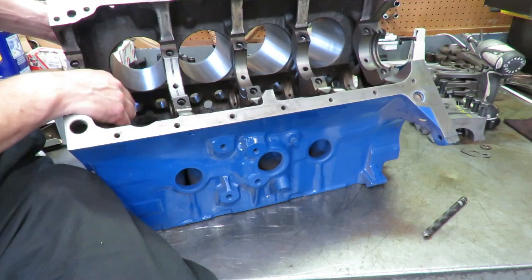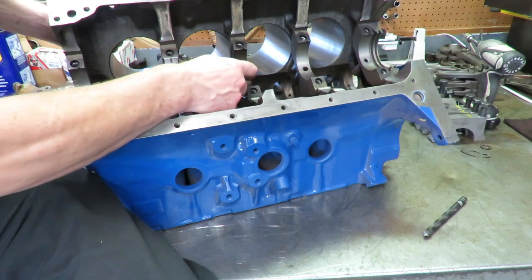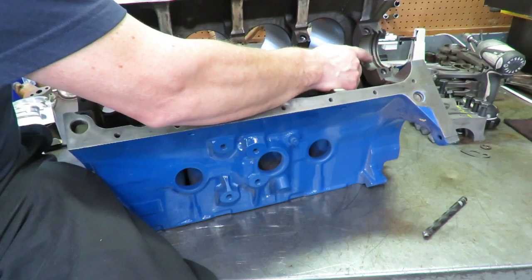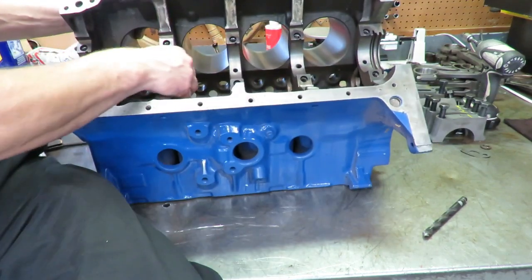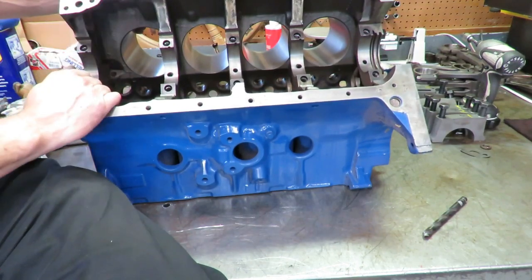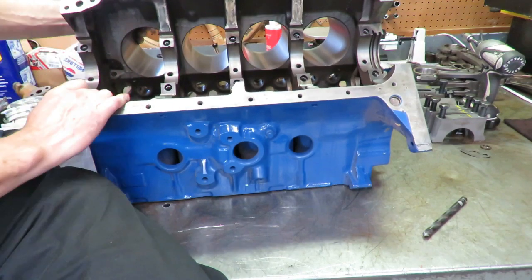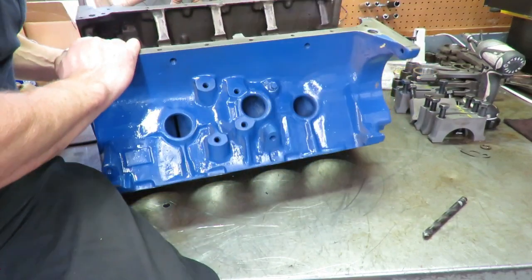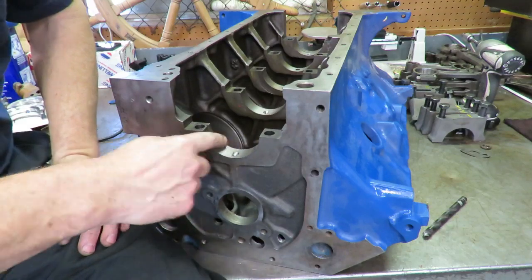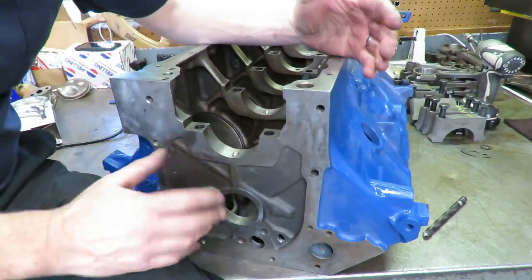And you see that they've all been kind of modified there. The center hole matches up pretty good. We made it slightly larger, but we had to offset these, and then the back one, we just enlarged it slightly because it's pretty centered to the bearing. So those are some oil mods that I would recommend doing. Took a while to do it, you know, with the Dremel. You just got to take your time and drill that stuff out. And we took a very fine sand cone and we polished these and made sure that they were all deburred and so forth.